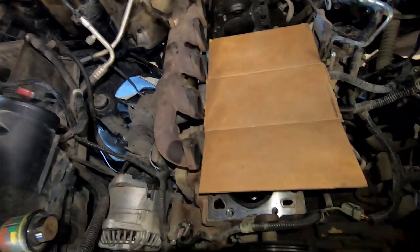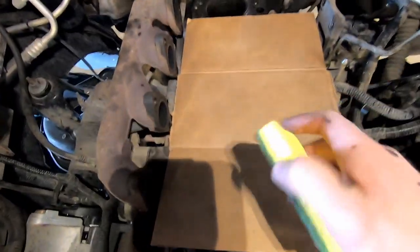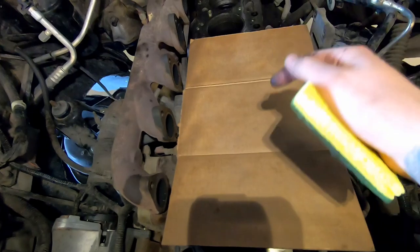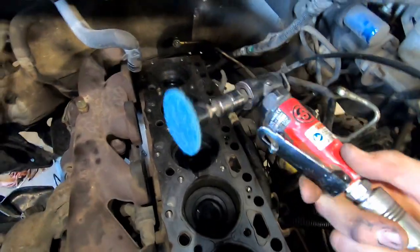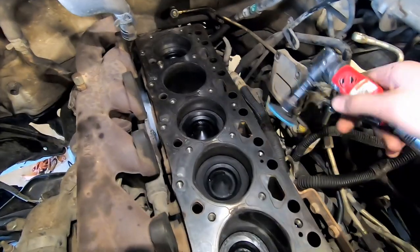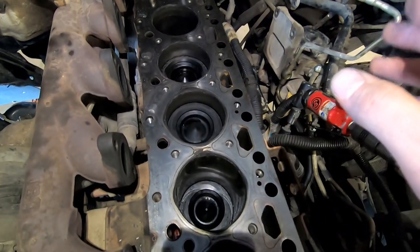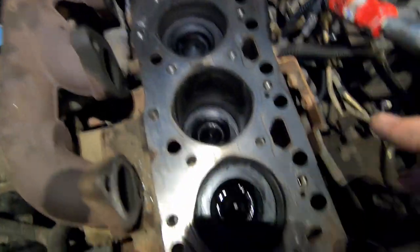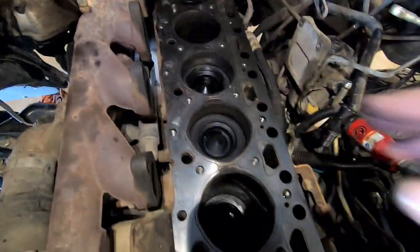Just before I clean the deck, I'm gonna grab an SOS pad and buff these exhaust manifold flanges a little bit to clean them up, because once we get the head in there we won't be able to get at them. The cardboard is here just to prevent debris from falling into the engine. I'm using this little buffer wheel pad — you don't want to see sparks. The blue color shouldn't dig that deep. Sparks are bad because you don't want to take material off; you just want to clean up the crust and crud.